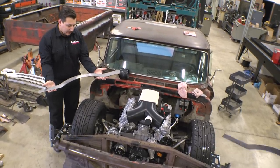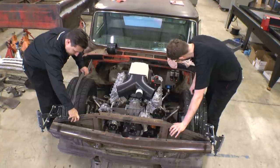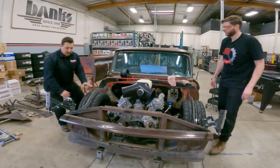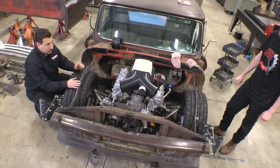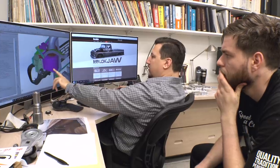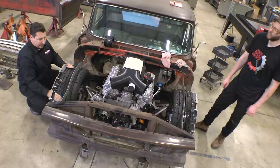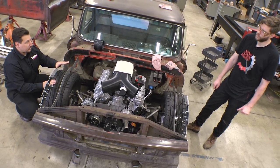We made a couple of mock-up pieces on the plasma cutter. We put it back at droop, put the inner fenders back in to grab reference measurements, and started talking through our design for our own core support spreaders. Now with these in here, we're going to build a more permanent solution. When it goes to sheet metal, Sean may or may not use those, but for now it's going to get everything shored up right where we want it. It's going to help me in CAD as I design our air filter boxes. Now when we close the hood hinge with the support braces in, I can get my hand under there — we have the gap we needed, so we've got clearance. We're fully slammed right now.